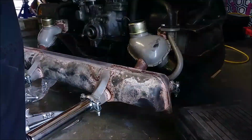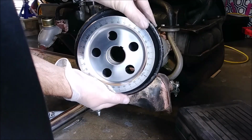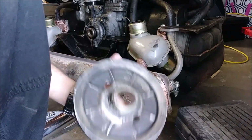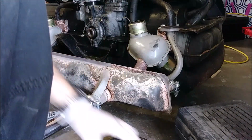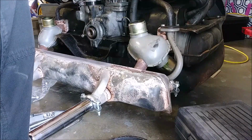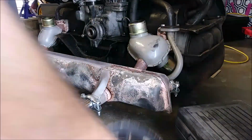Okay, it should be noted, this pulley is significantly shorter than my stamped steel one. So, I'm going to use the belt. Hopefully I can use my belt. I did just buy a new factory belt. It works properly. I may have to use more shims with the belt higher up out of the channel, but maybe the belt sits higher up in the smaller pulley.